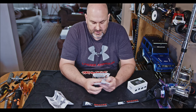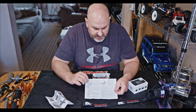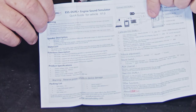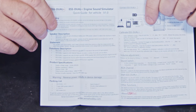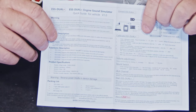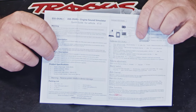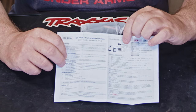The guide walks you through what you need to plug in. You have a servo plug that goes to your throttle and one that goes to an auxiliary channel, which lets you assign a sound to a button - so you can have a car horn, gunshots, or pretty much any sound you want. You can also make your own sounds.